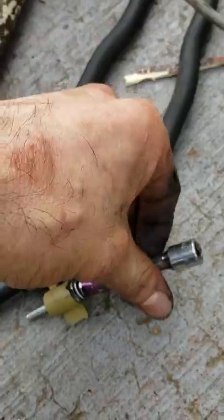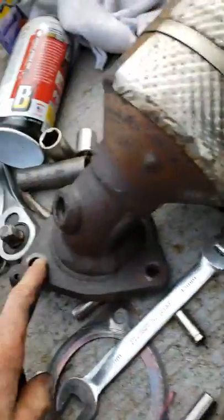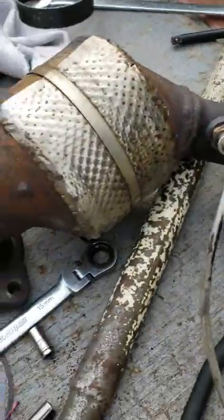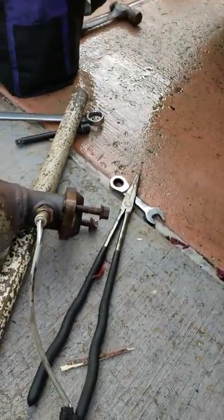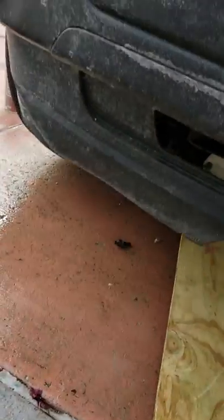You put it on there and start turning it. Everything was very challenging — the bolts, the angle on this one, it was just rusty and seized up; I needed to heat it up. Be prepared. This is a 2013 Ford Explorer 3.5 with the turbo. The catalytic converter on the front has to come out.